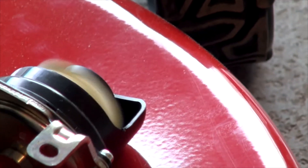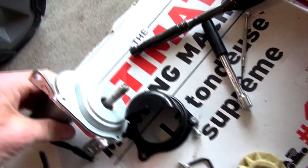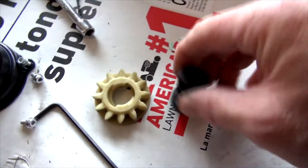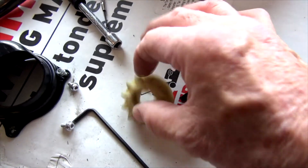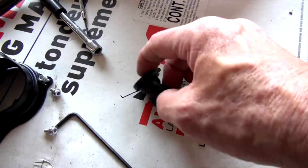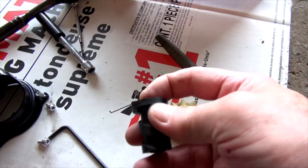It works perfectly every time outside the machine. I took the top off the starter motor and looked at the gears, took the C-clip off the top. I noticed there is some sort of irregularity on this gear — there's a bump which could cause this gear to stick when it's up in place to activate the flywheel. So I'm going to file that off, put a bit of lubrication on it, put it back together, and see if it works.